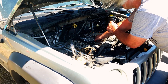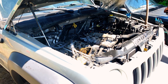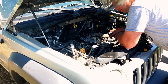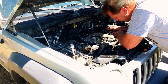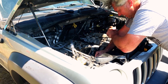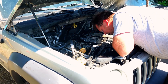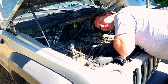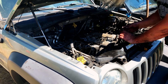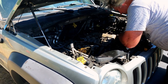Pull this belt tensioner off first — belt tensioner and idler pulley. I'll just set those parts right on the black paint on the car next to me. I'm sure a few scratches aren't noticeable. I don't know if this coolant's drained or not, probably check on that first. Coolant has been removed, as well as the upper and lower radiator hoses. Continuing with the water pump removal — I don't even know if this has to be done or not, but I'm just taking stuff off.